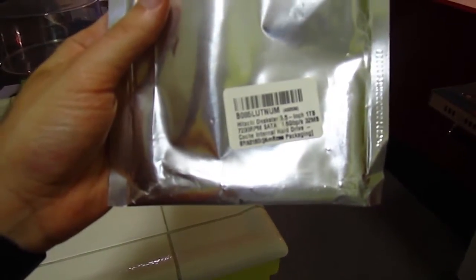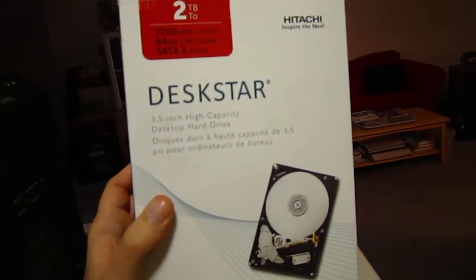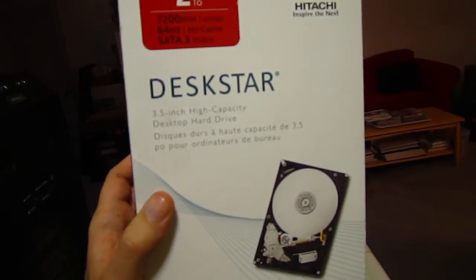Are those normal hard drive sounds or is that a failing hard drive? My first system hard drive isn't doing that but both of the new ones are. The first hard drive I got for the system drive is a Hitachi DeskStar 1TB and it's been working just fine. When I got more drives for storage I got the same brand and model except 2TB with a larger cache — though that was actually an error by Amazon. But those drives set up in RAID 1 are giving me trouble with chirp-clicking. While I'm video editing and trying to play back video it keeps chirp-clicking and then the video stops playing, which is really annoying.